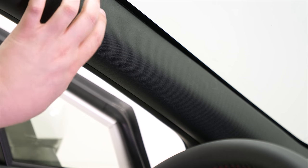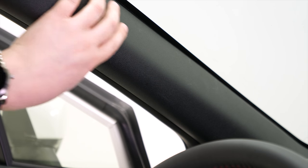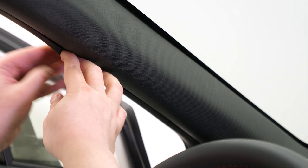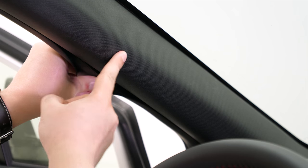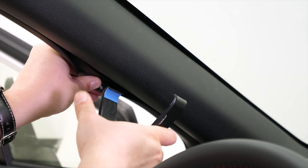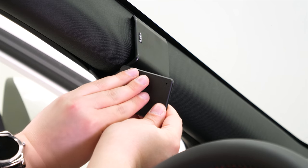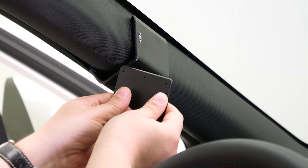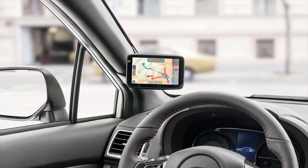This mount is going to attach to the interior plastic piece that covers the A-pillar. It can be attached anywhere along this piece. The first step is peeling back the weather stripping. Once you have that peeled back, you'll notice there is the lip of this plastic piece under here, and that is where this lip of the mount is going to attach to. You just want to slide it in there. Then press upwards until this side snaps around the lip that's up by the glass. Once you have that in place, you have a nice solid mounting platform for a custom ProClip device holder.